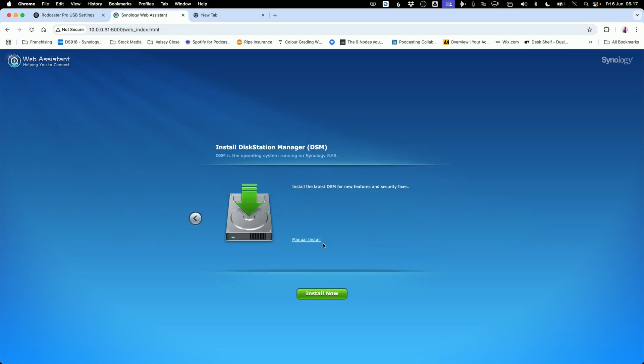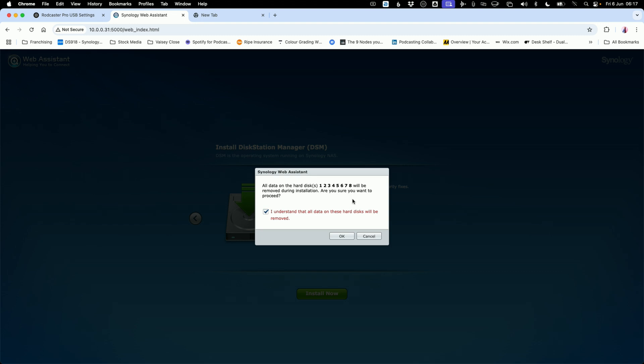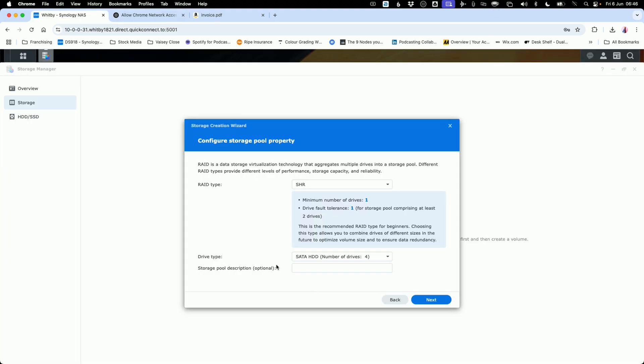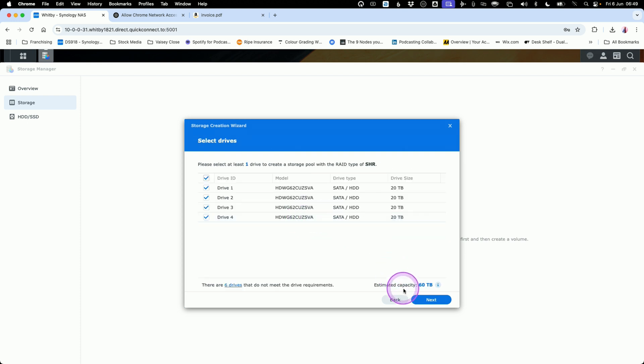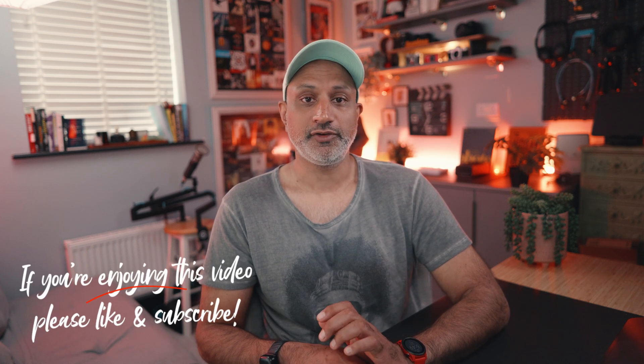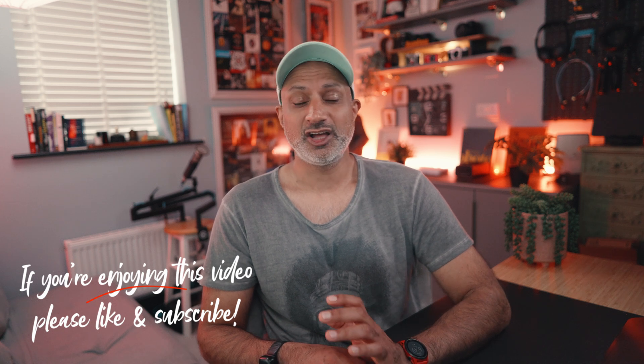Then it came time to boot up the NAS and set up my RAID. I connected the NAS to the switch using the native 1Gb ports. Installing DSM is super easy — you just go to find.synology.com and any NAS on your network will show up and you follow the prompts. I'm not going to do a detailed step-by-step here; there are plenty of tutorials on YouTube from people who know more about this than I do. I created a RAID 5 or SHR1 array for my spinning hard drives, giving me about 60-odd terabytes of free space, and a RAID 0 pool for the SSDs to maximize speed. It's really important to note that initialization can take several days — mine took nearly three. So if you've got large drives, be patient and don't run speed tests or stress the system until it's complete. You can, however, create shared folders and start copying footage if you wish.